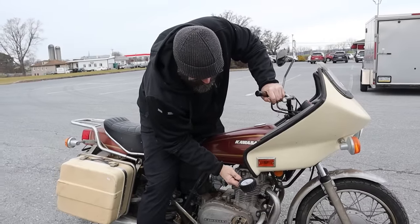Guess we have a little in the IV bottle yet if we need it. Okay, this is going swimmingly. All right. Now, this is a vacuum-operated petcock. So what that means is there's a secondary line coming into this petcock that's running off of vacuum pulses from the intake track, and that's working this little diaphragm, and that's allowing fuel to go through.